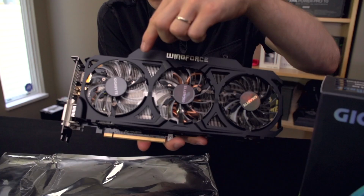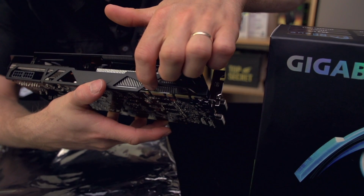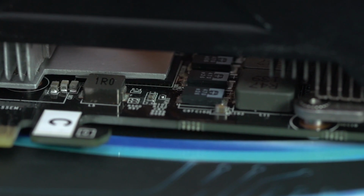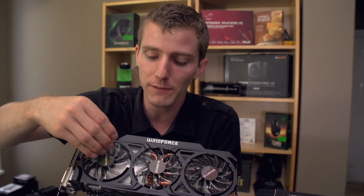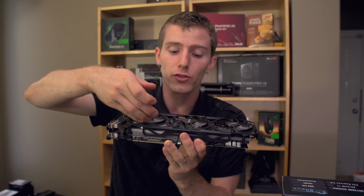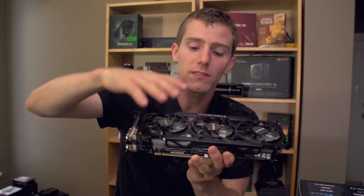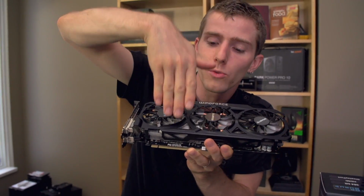Now for the rest of the card, check out over here. What Gigabyte's done is they've used a sort of unisync type design. So they've used a large full cover design that is able to make direct contact with not only the GPU, but also the RAM. And then they've put what they're calling their triangle cooler concept on here. And what this does is a couple of things. So it redirects the airflow. So airflow from these 2 fans here is still going down towards the card, but because there's direct contact between the heatsink and the components underneath, the air doesn't pass right through. So what happens is they're using this triangle shape, which is kind of shaped like this from the side, if you guys can kind of imagine that, to direct airflow down towards the PCI Express slot. This should help with motherboard cooling a little bit, as well as up here away from the card itself.